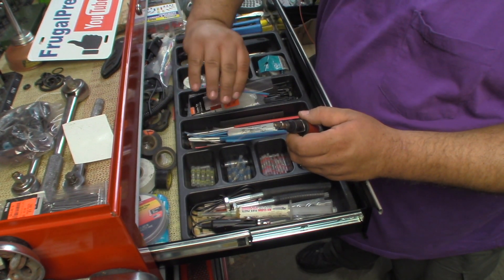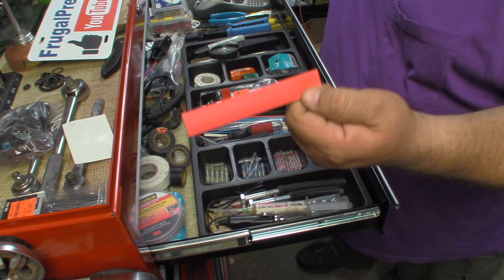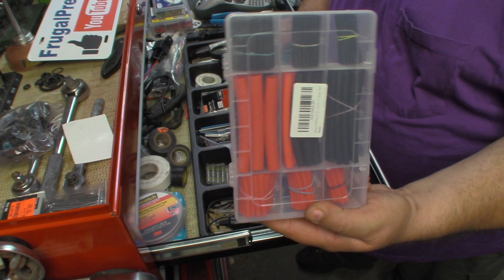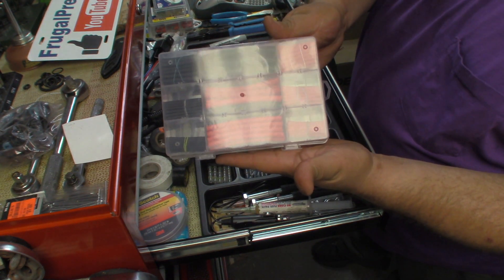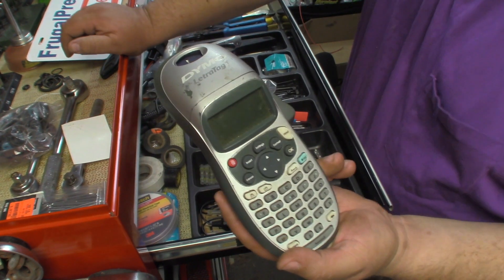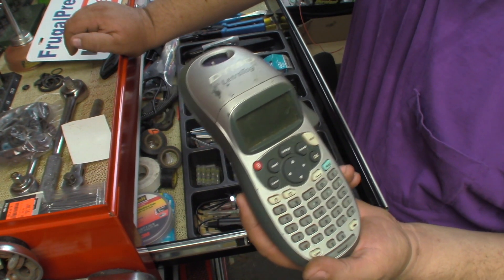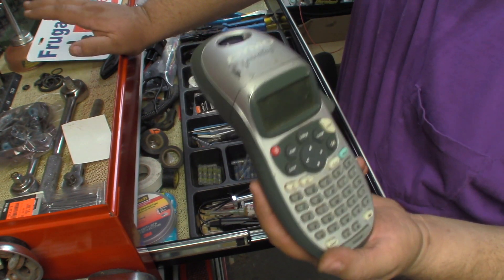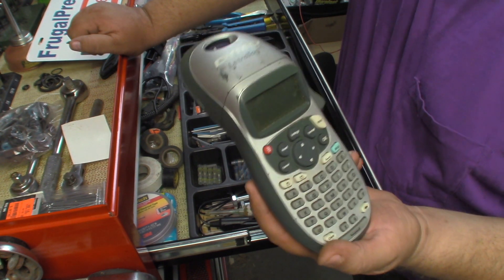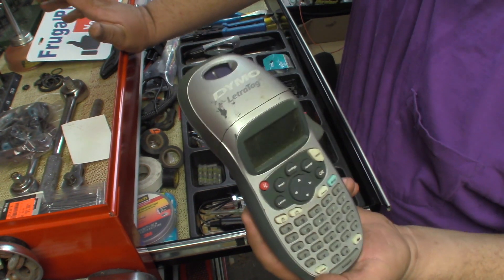I've got some different sizes of heat shrink — this one is not self-sealing, so if I use it I seal it with some liquid electric tape. This is the self-sealing 3x shrink tubing with a whole bunch of different sizes in there. I keep a label maker in here too. Sometimes I have to run a wire outside of a harness where it's broken because the harness is just too hard to get to, or the customer is limited on labor and can't pay me to tear the whole harness apart at my hourly rate. If I do that I'll always put a label on it — like 'this is for AC compressor' — so if somebody else looks at that wire they know what it's for.